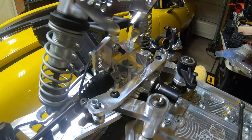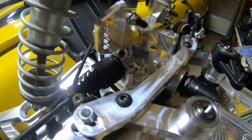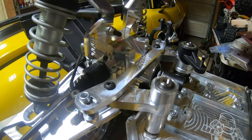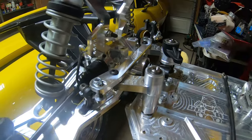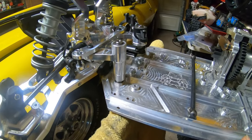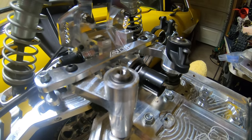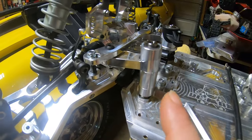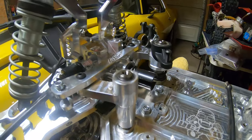One little piece that I really liked that I've never used before is the ADI steering rack - it is definitely a beautiful piece. Just so you guys know, if you're going to use the ADI steering rack you have to use the 1.0 servo saver horn. This chassis can be set up as a 1.0 or 2.0 - I'm setting it up as the 2.0, but the ADI steering rack is based off the 1.0, so you've got to use the 1.0 servo saver. I also used the titanium steering rack post on it.